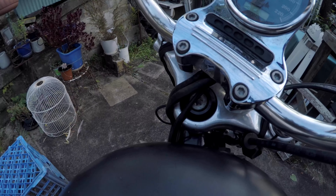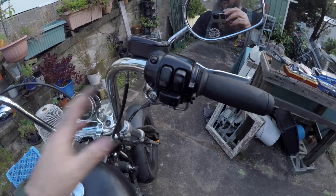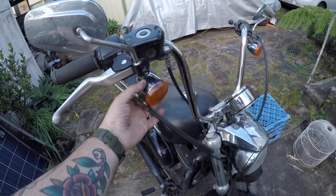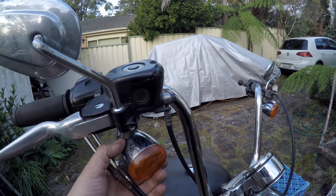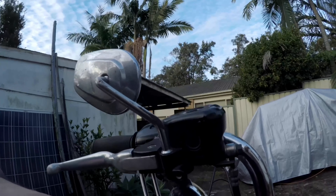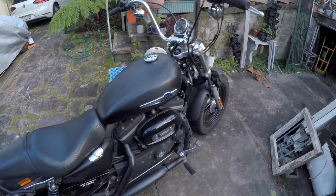The bars are on and I just have to make some minor adjustments - tightening things up on both sides, readjusting the mirrors, and readjusting the indicators. In here there's a grub screw - you turn that to loosen it and you'll be able to move the indicators around using the ball joint on the inside. Aim them straight and tighten the grub screw back up. Do the same on the other side. I'll show a photo of the finished product once it's all done.